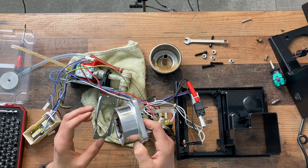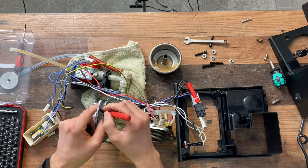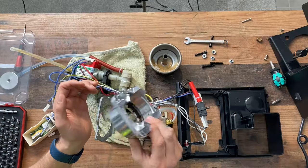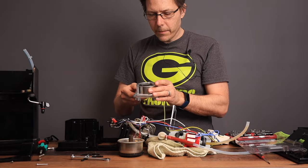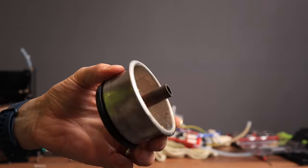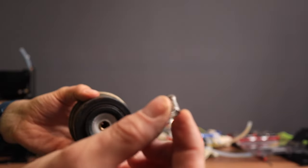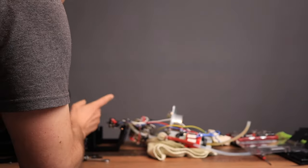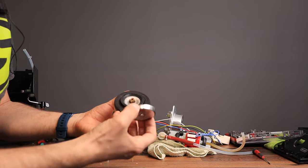The brew group turns out to be aluminum, not brass — it's very light. Here you can see the lock-in part of the brew group, and the bottom part of the boiler with that sandy residue. The valve closes in like that, then the shower screen goes on top, and your portafilter comes on and screws in.